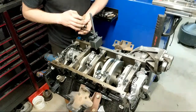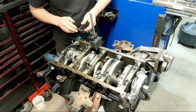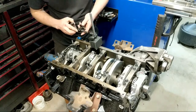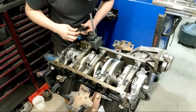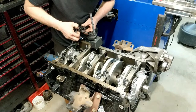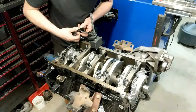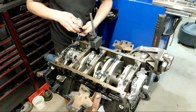I'm not going to tighten it yet because I want to show you guys a little something. We're going to set this thing at 20 foot-pounds for now. I had to grab my dial indicator. This is a little trick I just kind of figured out on my own - you can actually measure the clearance with a dial indicator once things are at 20 foot-pounds only. This is a 63 foot-pound rod bolt, but I want to show you guys a little rod stretch action while doing this live.